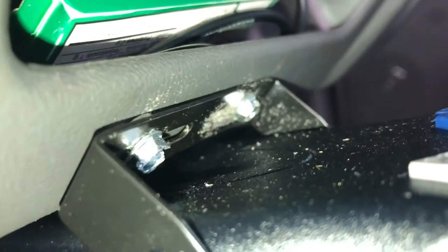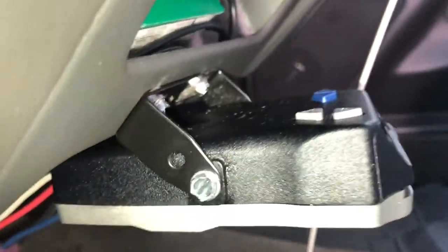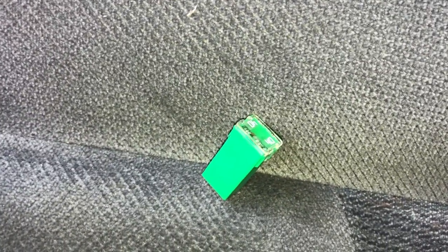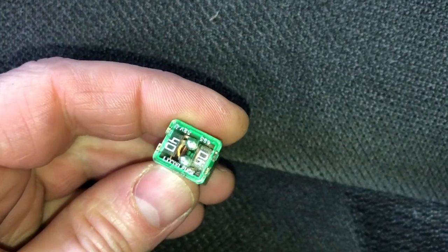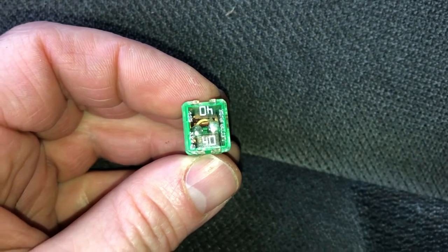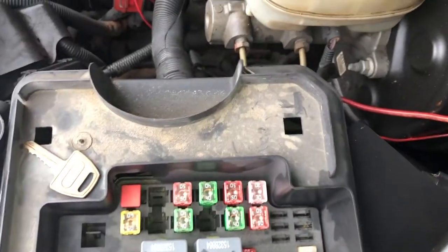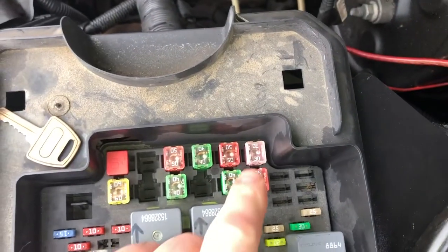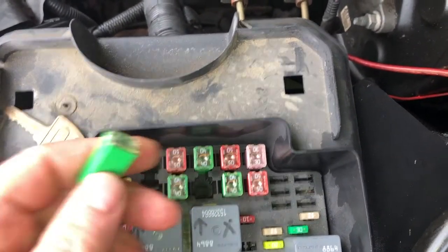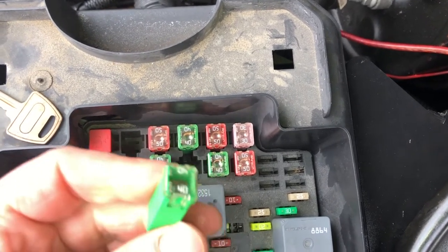As you can see, I just used a couple of screws right into the bottom of the dash to hold the bracket for the controller. That GM-supplied harness that came with my truck also came with one of these 40-amp fuses. I thought I had to install it, but I think it was just a spare — there are only three 40-amp fuses, and one of them also powers your trailer brakes.